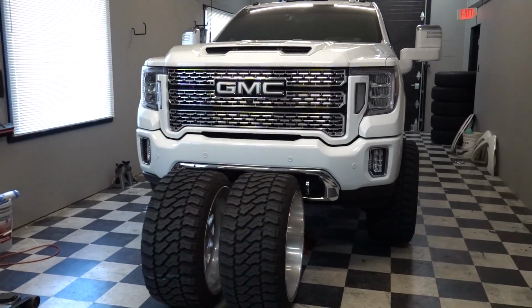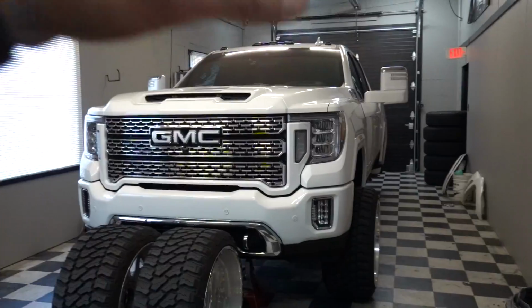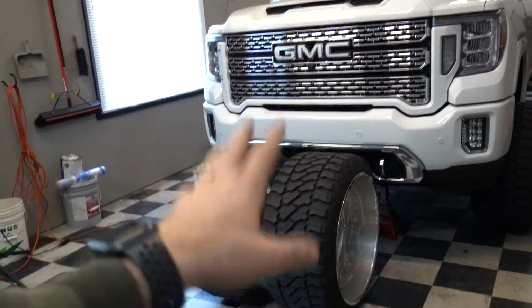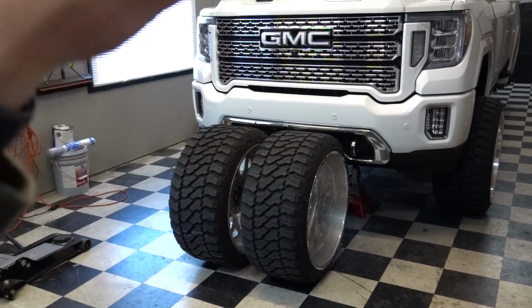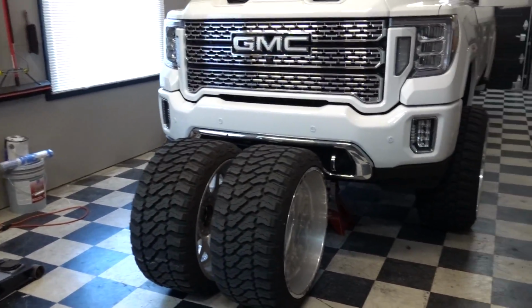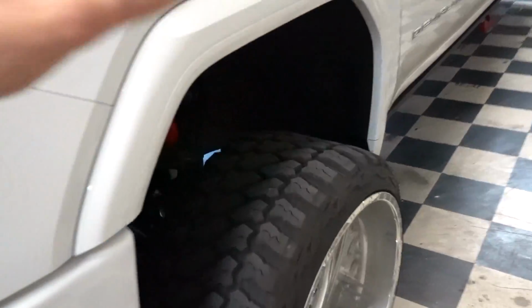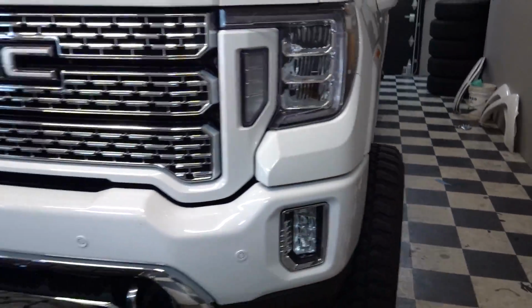If you're in the market for quiet tires, I wouldn't suggest going Furies, but if you wanna pull something off like me, with a unique setup where we're just leveled, running a 24x14 American Force wheel, negative 73 offset backspacing, with a 33x14.5 tire that has just a little bit of stretch and no trimming on a truck, you kind of have to conform to whatever options are available in the market to make that work.